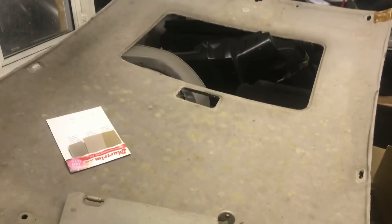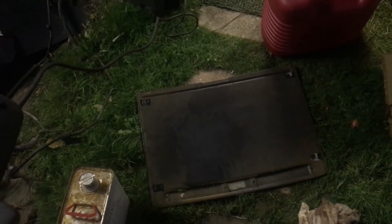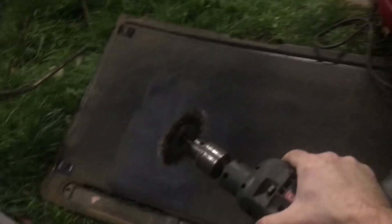This thing is quite flimsy and the more I have it balanced on random bits of car interior trim the more it's going to get damaged, hence why I'm getting a wriggle on. That's the interior panel from the underside of the sunroof - I'm just trying to get the old glue off. I tried unleaded and panel wipe and neither one touched it, so I went to find some thinners. Whatever that glue is it's pretty good stuff because even the base coat thinners wasn't taking it off. So now I'm using a wire brush on a drill, trying not to damage the paint because it's actually really good and not rusty. I'll get the worst of the glue off with the drill and then find another solvent for the remains.